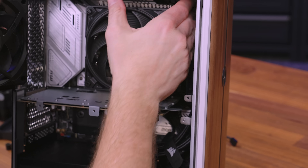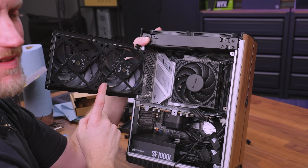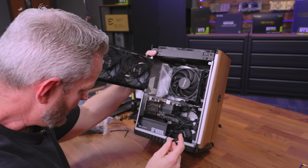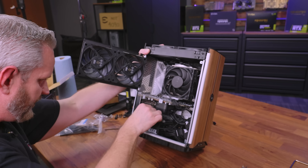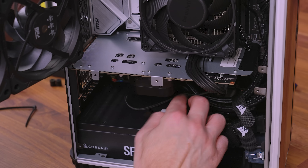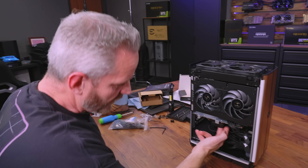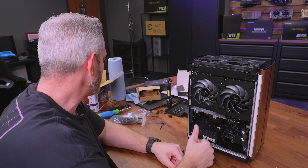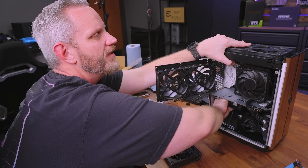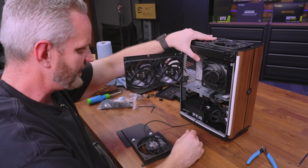Triple fan splitter coming off the CPU header is now controlling these four fans. These two are daisy-chained, so I only needed a triple adapter, not a quad. That plugs into system fan one. The Corsair AIO stuff is removed from CPU cooling. The 240 for the GPU is still there. Now I no longer have to worry about fans ramping based on liquid temp — which is absolutely not how I'd set it up, because liquid temp takes too long to rise.